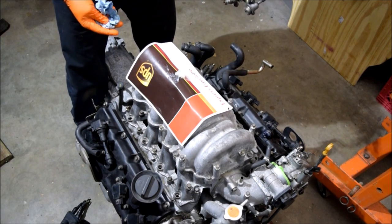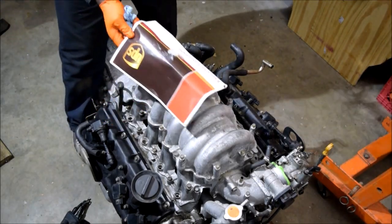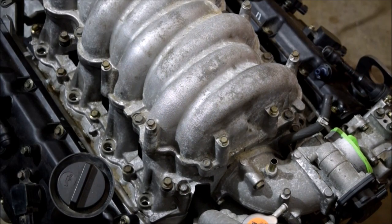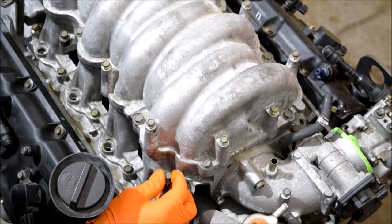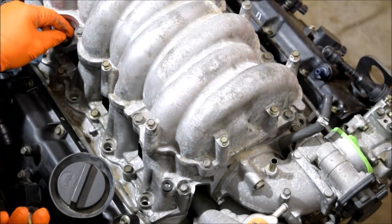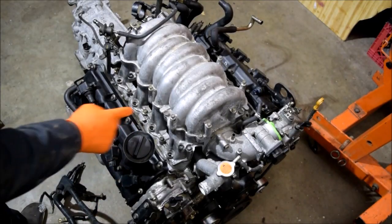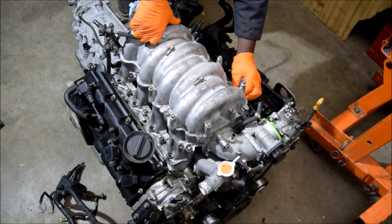So I've applied my Vaseline. There's something I need you to see over here — these are the spaces. The normal setup for the fuel system is this: you have your bolt holding your fuel rail down, but you also have a damper. This is the damper — the plastic thing over there. I'm going to remove the bolts; these are 12-millimeter bolts. You have four of them — one here, another one here, and the same thing on the other side.